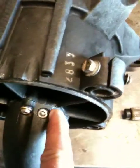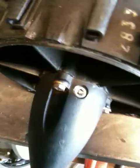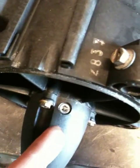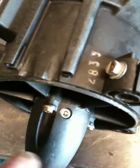To check the oil on the jet pump, all you have to do is undo this hex nut and put a nail or something like a little dipstick inside to check the oil. If the oil is gray, that means water got inside the seals and it's time to replace the seals — do the bearings at the same time. But if the oil is still dark and brownish, just remove the old oil and put some new oil in, and the jet pump should be good.